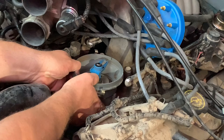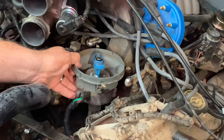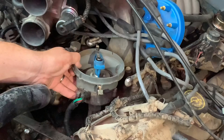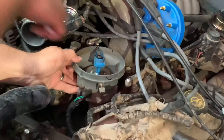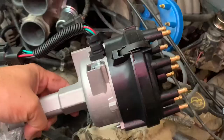We begin to give a little twist and pull action here. You'll notice the rotor turns as I pull upward. Wherever the rotor stops turning, I want to make another mark with my permanent marker — I'm going to make two marks because that is the final point it was pointing at. You can also use your marker where your wiring harness is pointing to draw a straight line to help place the new one. When you pull this up, be very careful because the oil pump is driven off of a shaft at the bottom — we don't want to pull that up with it.